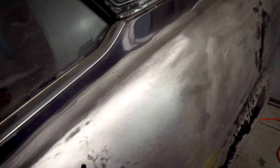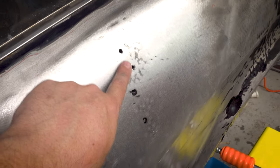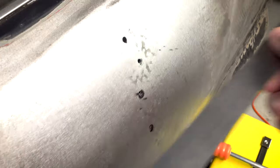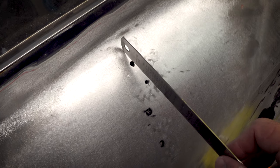To illustrate that and see actually how accurate I am, because I haven't done bodywork in a while, what I'm gonna do now is black out this panel, and then I'll get a longboard onto it and we'll file over it, because basically on a curved panel with a straight edge, it's hard to know for 100%. So if I take a sort of a 12 inch longboard and sand it over this, we should get a better representation of this. And what I'm hoping to see is a very, there'll be a large black spot here, I'd imagine, similar size to the last one, but it should only be about half a millimeter to a millimeter deep. So that's what we're looking for. If I get a black area like this, that's great. If I get a very silver area with black on either side, this is still high and we need to knock it down a bit.